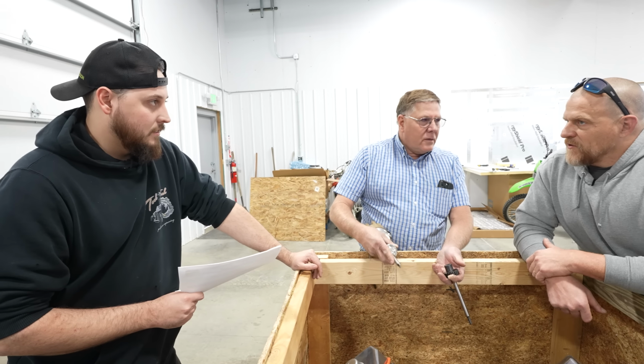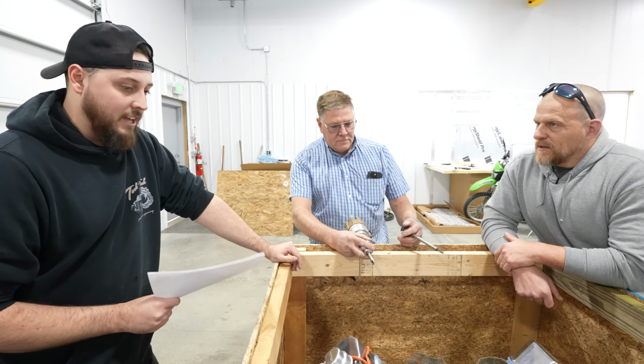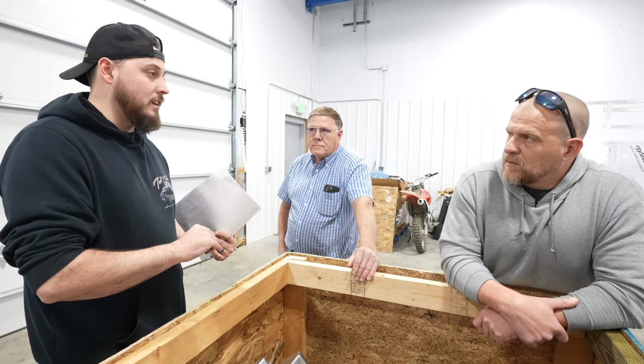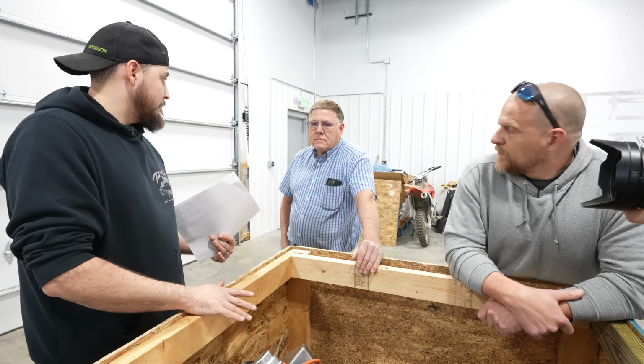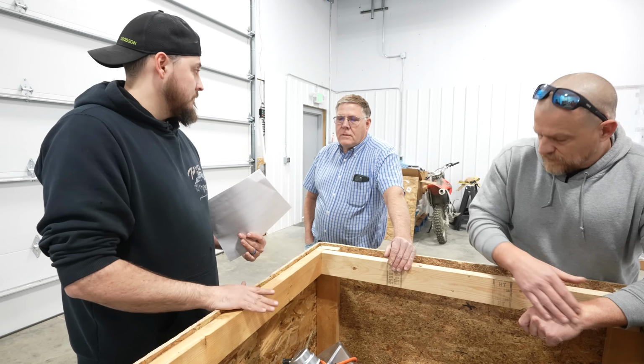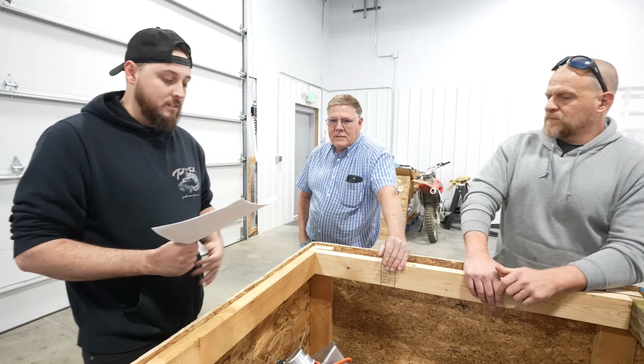So you fought that the first day. We fought that the whole first day. Once we changed that intermediate shaft, you could bring it up to 4,000 RPM, and Pete said the timing was steady, held it exactly where it should be.